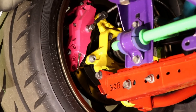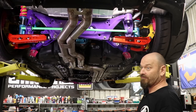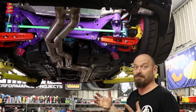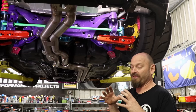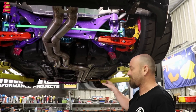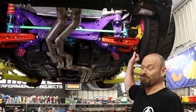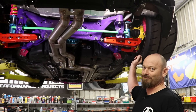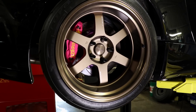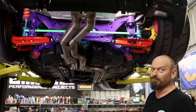The vehicle has had a 5×114.3 stud conversion done to make it easier to source wheels, because the 5×100 really limits your wheel options — and the hubs are much stronger with bigger bearings. The rear hubs are off-the-shelf Subaru STI items, but the fronts are a custom unit from Japan. The car has had at least three sets of wheels on it. The current set — TE37s, the latest forged edition — are by far the best in my opinion because the wheels are facing upright. It's got plenty of rubber on it so it might actually grip the road this time.